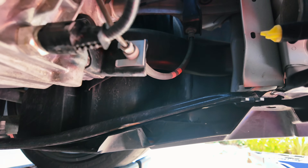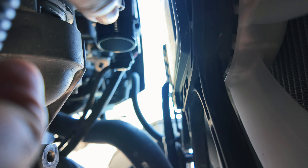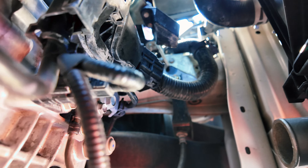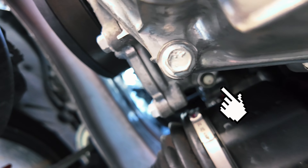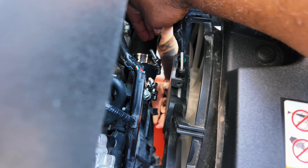We're on to the car. We already did most of the work to take these pieces off — if you've been here before, you know we already put on the Six Element intercooler. The cold side is off; it's going to go all the way up to the opening at the top, and then meet up with the intercooler down here. For the hot side: that pipe flows down here, attaches up to the bracket, and goes all the way up to the top where the inlet pipe is.